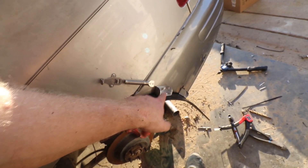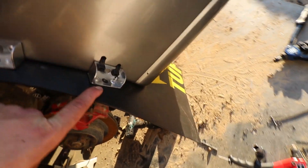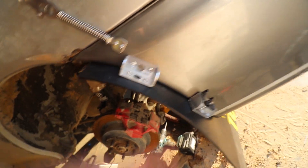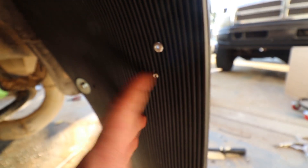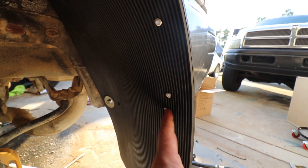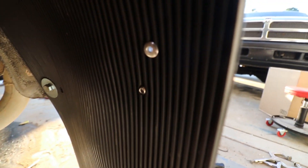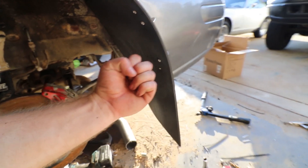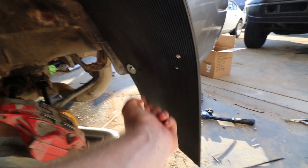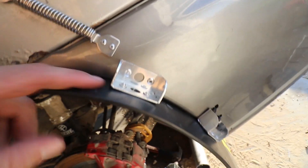Kind of went off camera for a little bit and worked on the car. Rivets weren't really working - they worked fine up here into the bumper, but down here they were just ripping right out. So I ended up doing two holes and zip tying it with some really hefty zip ties, and it's actually super strong. Then I riveted the mud flap to the little mounts. I ended up going backwards initially - drilling a hole through the rubber and a normal rivet just expands a little bit and pulls right through. So I started going from the other side because it's aluminum and won't expand through aluminum. The large flat side went from this side, and the expanding side went from that side, so it's a lot sturdier.